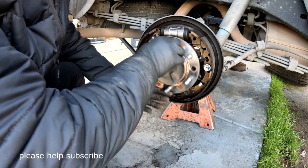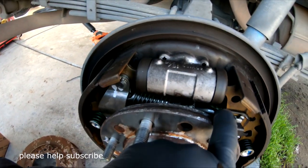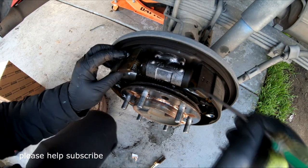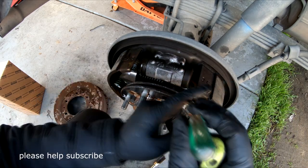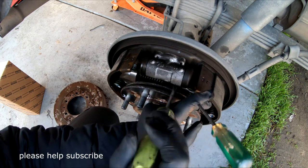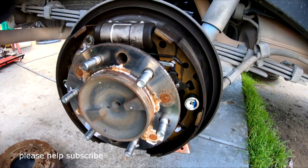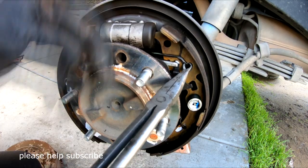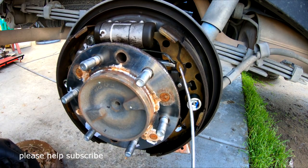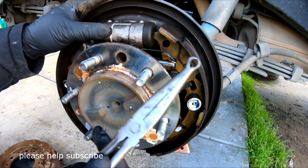What you can do is back off the, I don't know what they call it here, back off the spring first. Okay, I'll show you. Inside here there's a spring, right? So use two screwdrivers, one to press the locking, and then one to turn the wheel. Okay, turn up, making this one untension. Okay, when you get your spring all the way, the wheel spins back all the way, then you just press like this, it comes off. Or you can use a flat screwdriver or any screwdriver, just pry that off too, it doesn't matter. I use this right here because it grips better.